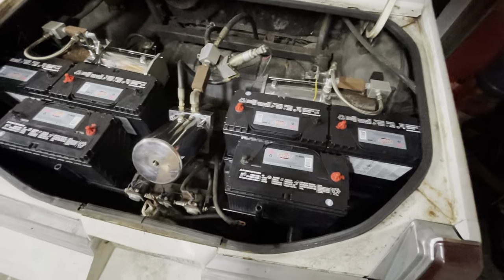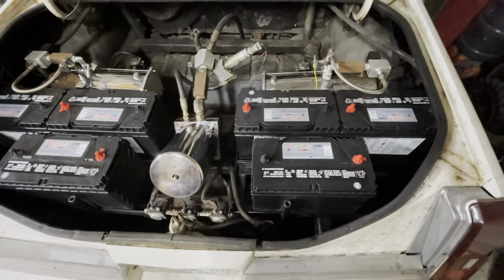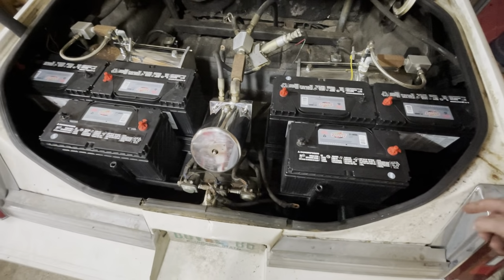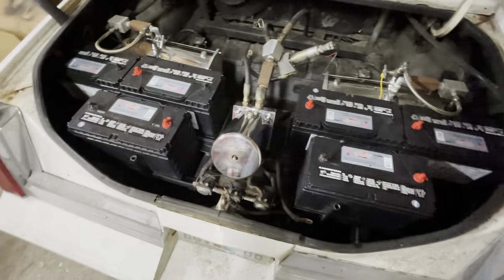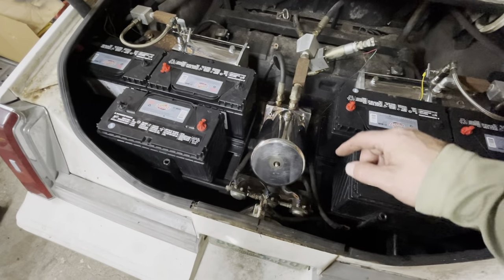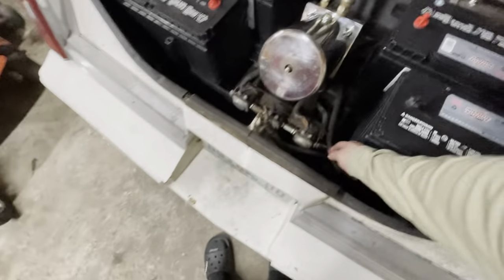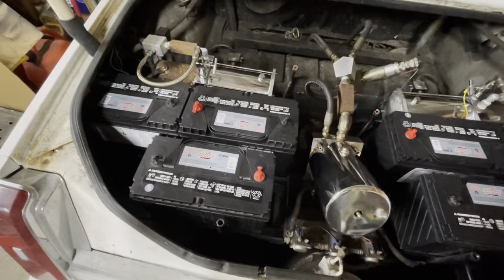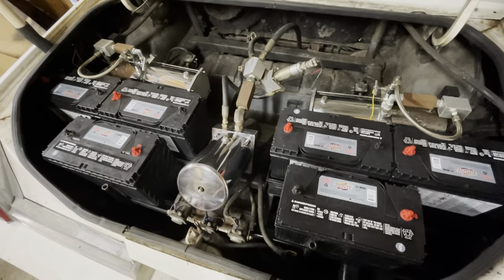All right, so I got the rack cleaned up on both sides, wiped everything down again, threw in the batteries for now. This rack was set up for 8 batteries originally, but I had it too close to the taillights and they would hit, but I only plan on running 6 for now anyways. Gotta get my tie downs, or my hold downs, on, and then I need to also clean all the leads for the cables and stuff like that, just to make sure that they got good connections. And we'll see, hopefully soon, if this thing will still work.